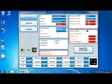Another new feature is this one, starting petrol cycles. This function allows you to set a number of cycles to be done on petrol when the engine is hot. So when you have gas start with a hot engine, you can select a number of cycles that will be made on petrol anyway. It's useful to wait for the start or to keep the petrol injection at the best efficiency.